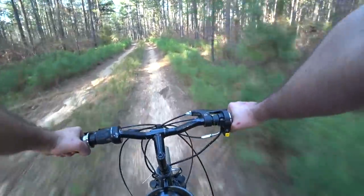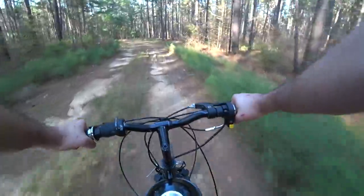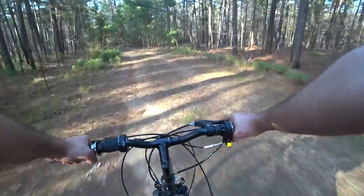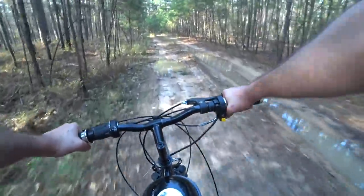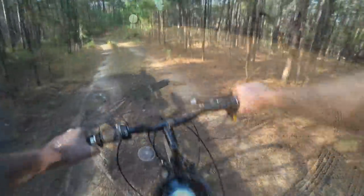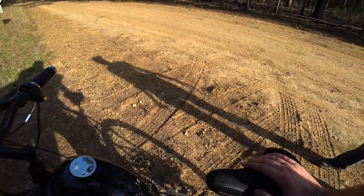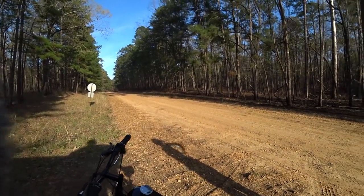It four-stroked in the low RPMs, bogged in the mid RPMs, and never got to the high RPMs. Although I'm in the break-in period and I didn't really try to push it to high RPMs because that's just not a good idea, there was definitely no performance gain and it was lackluster at best. It is so loud. I don't know anybody who would want to ride with the muffler cap out.